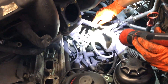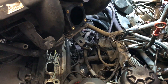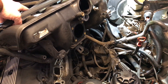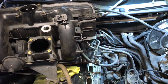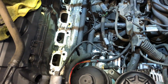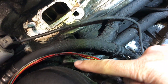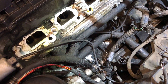More little surprises under there, still connected. The intake is off now - we put it to the side. We normally take it all the way off but this car has higher mileage so we're kind of just laying it over because there's still stuff attached. It gives us access to these pipes we're talking about. Here's one right here, here's the other one, and when you pressure test them they usually leak right at the cylinder head where they go in.